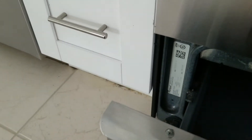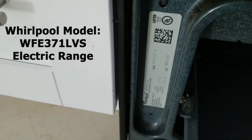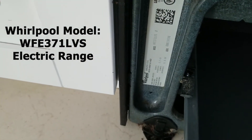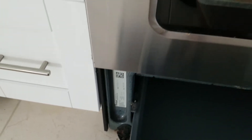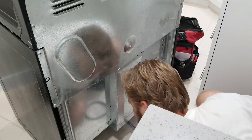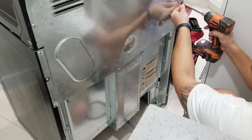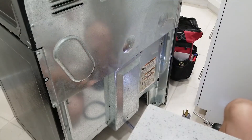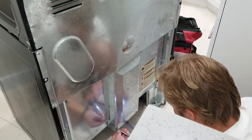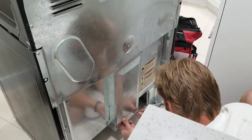If you don't know what model you have, you should find a tag inside the door somewhere, or the tray at the bottom — that'll show you a model and serial number. I should stop here and say: go ahead and check the plug and the breaker, get the simple things out of the way. I did that off camera. If you haven't checked that already, stop and go do that now. But that's not the problem — we should have 240 volts to the plug, and we do.